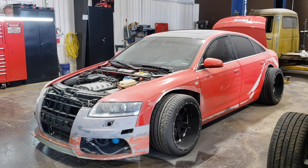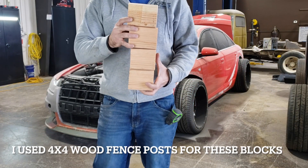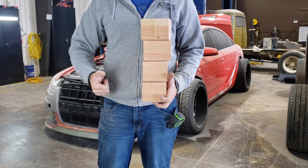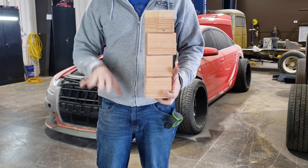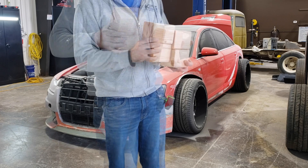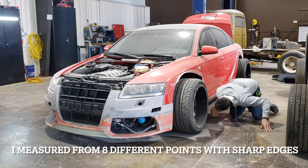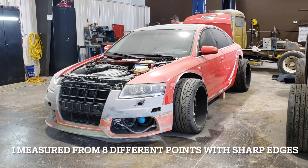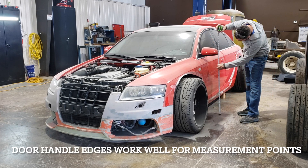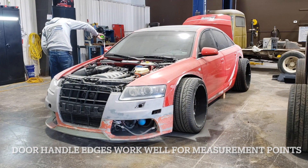As we build all the body kit, we're going to build off the floor up to it and we'll know everything's equal. Here are the blocks I cut — the four and a half inch ones go in the back, the four inch ones go up front. I lift the suspension, shove the blocks under there, lower it back down onto them, and we'll know it's all at an equal distance and everything will be square. I set all the blocks in place, get in the car to use the air suspension controller, lift it just high enough, then lower the car down slowly onto the blocks. Once it's lowered, I do a final walk-around with the tape measure to confirm all points are where they should be, and it looks good.